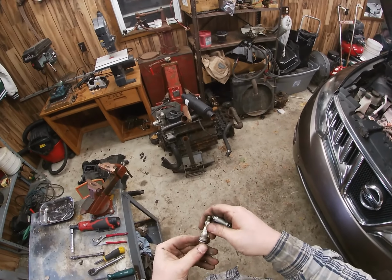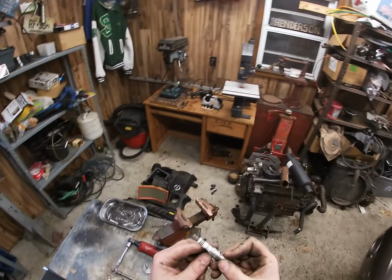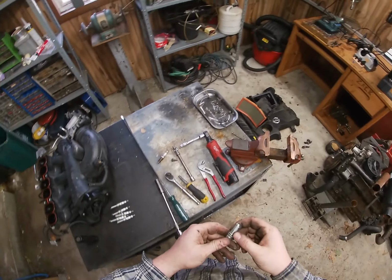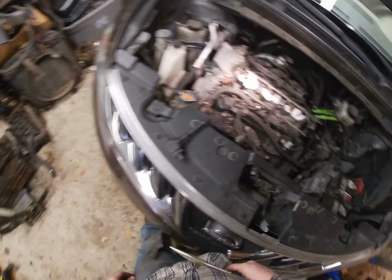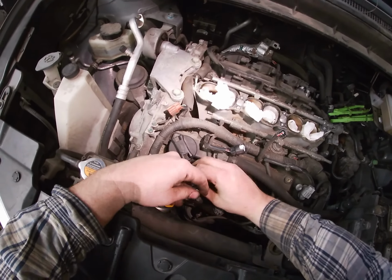Anyway, so Autolites were in there. So you could use Autolite XP5683, but I'm using NGKs. I like NGK. The NGK Iridiums, the 11S. Okay. So again, I don't have a magnetic socket, so I'm going to take this with my long nose, plop that sucker in there, and then do it by hand. Slip that in there. Catches the socket. Catches the spark plug. And then you start working it by hand.